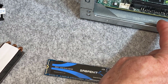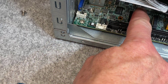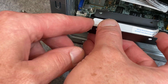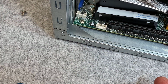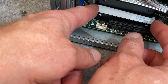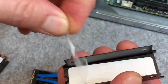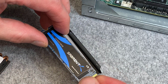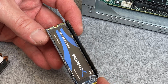So that means it's going to go on the back side here. Let's de-energize the motherboard. It's going to go on the back side here and fit something like this. Right? The motherboard has no power. We're plugged in like that, and it's actually going to be like an assembly there. So do you remember what I said about the notch? We're going to line up the notch, and it might be easiest to hold it by the pins. That'll work.